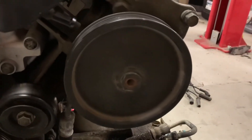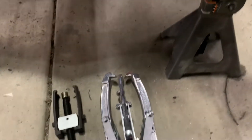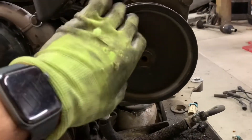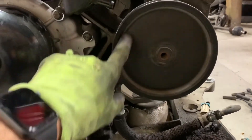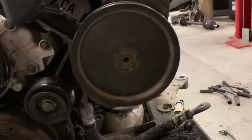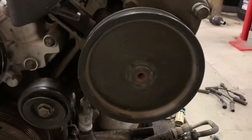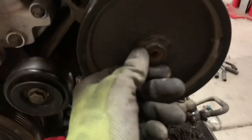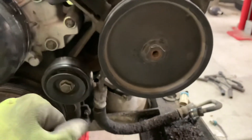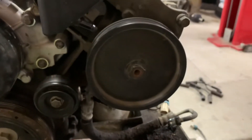I'm going to put it all on the pulley around the outside, which is definitely going to destroy the pulley, but it'll at least get it off. I think this is plastic out here, so it'll end up cracking and probably leave the center core on here. But right now that thing is just not good for anything, so I'll destroy it and get it out of there. At least I can get my bolts and my bracket so I can get the new power steering pump on the engine.